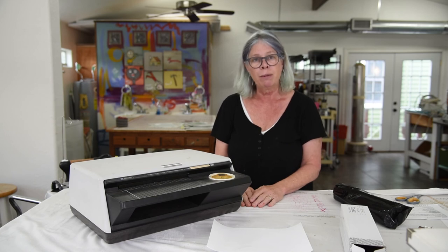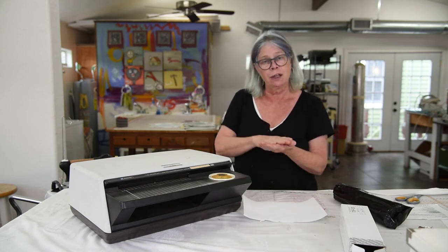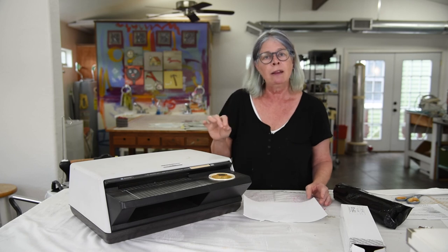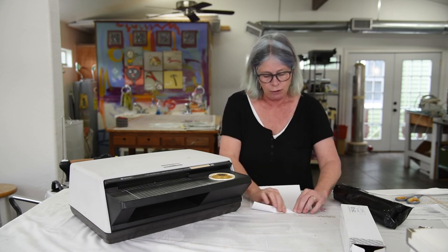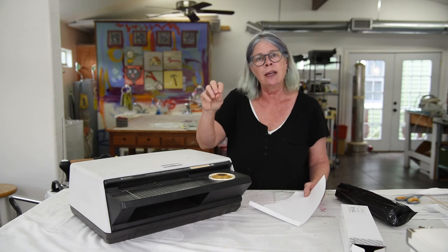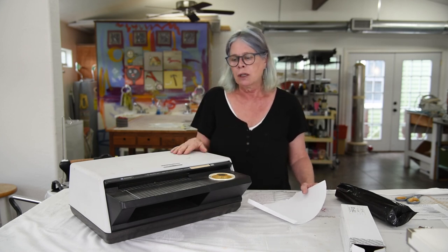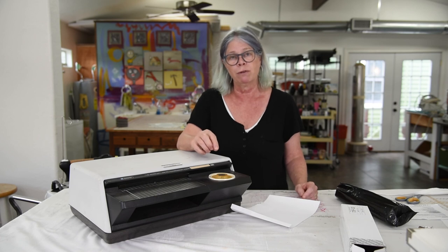The other tip: you may be using a plastic acrylic sleeve that used to come with supplies from Welsh Products — eliminate that sleeve and don't use it anymore. You can make a carrier out of regular paper, folding the edge back as a guide to run it through the machine. That plastic sleeve very gradually warps over time, and tiny minuscule bits of it melt onto the roller inside the machine, which can also shorten the lifespan of the machine. Replace any plastic carrier with a paper one.